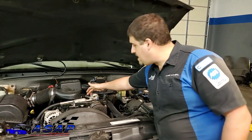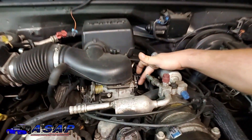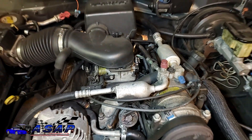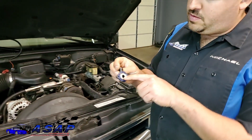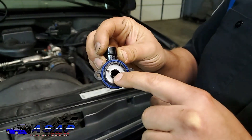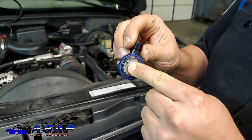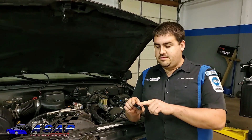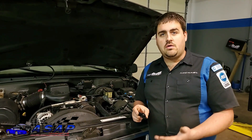It normally always goes on the side of wherever the throttle plate is, and it slides right over the end of the throttle shaft — that's how it moves and tells you where it's at. The end of the throttle shaft is rounded with a flat spot in it; it goes in there and pivots back and forth. The best way I can explain this: if you ever grew up with little slot car tracks, you squeeze the trigger and the car goes faster. That is a varying resistor — varying amounts of resistance. Same thing in here. It's just got a little arc of a sweep, and as you push the pedal further, the resistance drops so more voltage is able to go through.